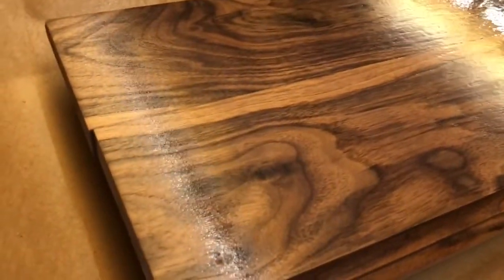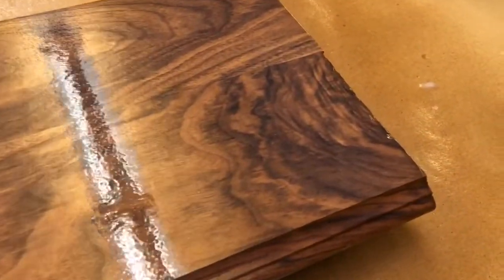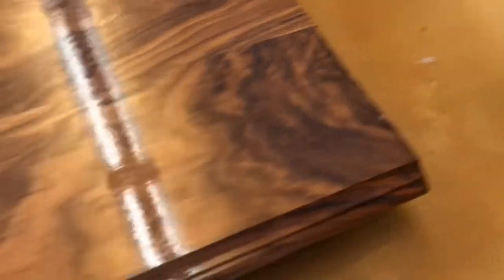You can see it looks pretty orange-peely, and a lot of guys give me crap about that, but that's the way water base looks when it shoots out. A lot of solvent base shoots like that too. I'll come back here in an hour and this will be dead flat and look great — just get an idea of what you're looking for out of the gun on this.